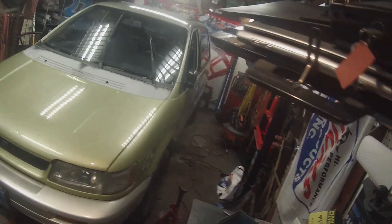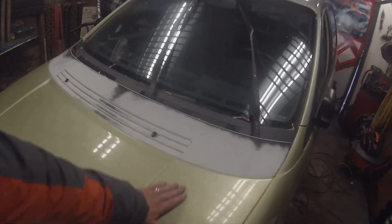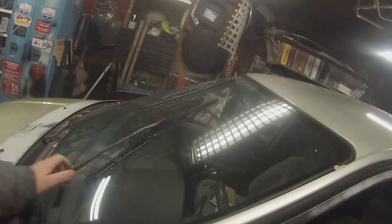The front brakes are all looked after - checked the pads for safety and made sure the caliper slide pins were lubricated, because they weren't. Now moving on to cosmetic stuff. There's an area that's supposed to be flat black but isn't, so I'm going to tape that off and paint it. My garage isn't heated and it's January, but it's fairly mild right now so I want to do the painting while I have a chance.